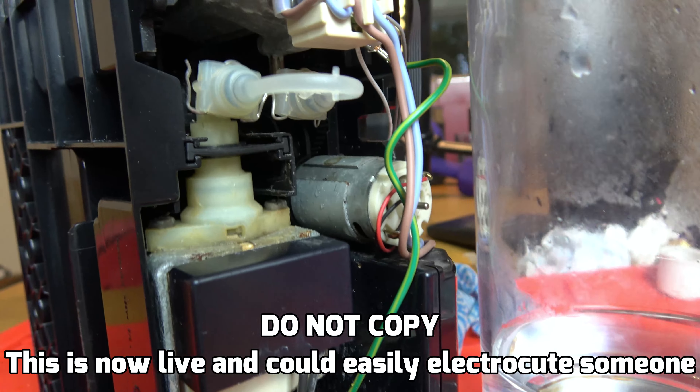This part is going back, but what is this thing here? The reason it's going back now is because this is a little spring - it's completely seized up and has come off one of its mounting posts. Even if it were still on the mounting post it still wouldn't work. So I take the spring off and start cleaning it with some isopropyl alcohol, and then it frees itself up. That's much better now - it's nice and smooth. I'm going to pop this back in and hopefully that will solve the problem of the lid not working properly.